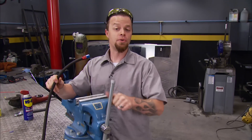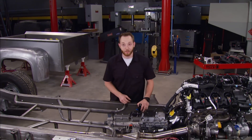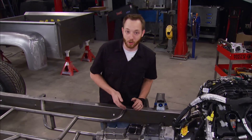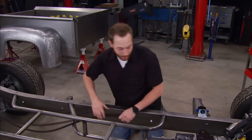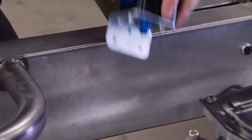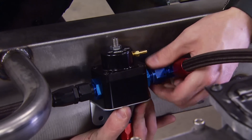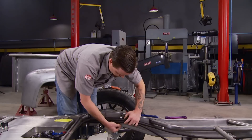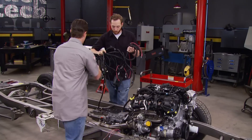It's a little more expensive, but trust me, when you're building a rig like we are, it is well worth it. These lines are super easy to work with, they save a ton of time, and you don't have to worry about cutting or bending any tubing or taking the chance of getting any kinks. We're going to be mounting our fuel pressure regulator from Holley on the frame rail. We're not exactly sure of the final position, so we'll get it temporarily installed so we can get the fuel up to the engine. We'll take the same approach with our fuel lines — even though they're cut to the exact length, we're not going to permanently mount them until after paint.